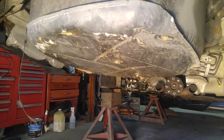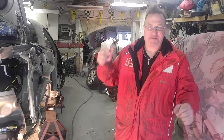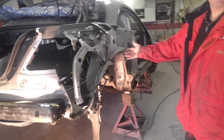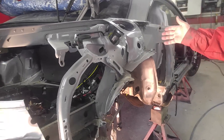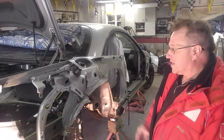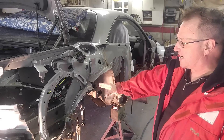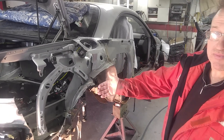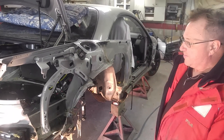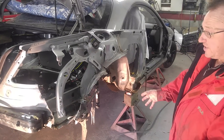This is Ray, the man who does the work. He's going to show you what's going on. Peeling away — it's aluminum, steel, plastic, and fiberglass composites. It's a slow process, a little complicated, but anything can be fixed. Especially in the back — it's actually a worse hit than the front. We're cutting away slowly as far back as we need to go and replacing with a clip section, welded in, riveted in, and glued.